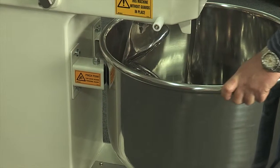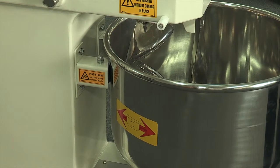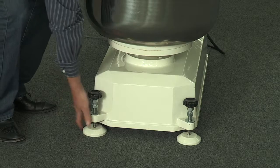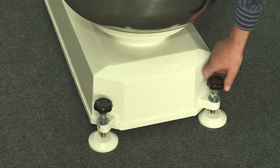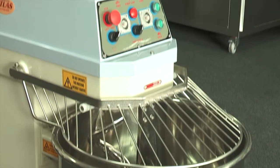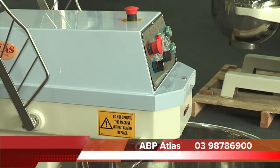The rollers at the back of the machine guide the bowl. Those bowl rollers should be adjusted well — any misalignment will cause excess noise or excess wear. Also, the stabiliser bars at the front should be adjusted down. On an uneven floor it's important to have those level so the machine is stable. Other than that, there are no other maintenance issues that can be done in-store by the owner. Any problems, please ring Domino Service & Supply or ABP Atlas.